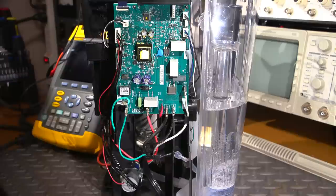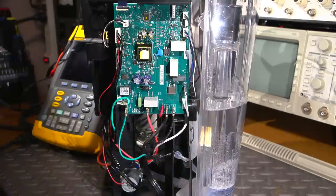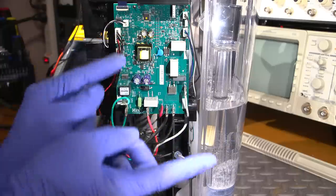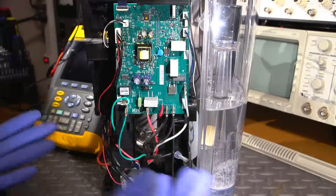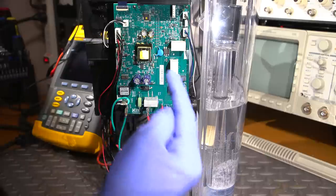All this thing needed was a little bit of RF decoupling - maybe three capacitors. An amendment to this capacitor value here, and some RF decoupling across the line cord: from the hot side to ground and the neutral side to ground, using XY-rated safety capacitors of the appropriate value. This thing would be almost RF silent. It keeps the switch-mode noise localized - a radio right close to it will still hear it, but I'm eliminating the noise with this radio sitting right beside the unit. Very simple fix.